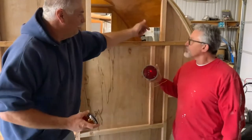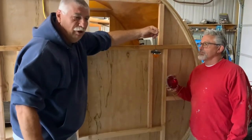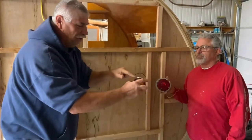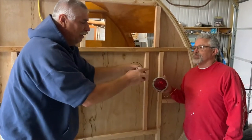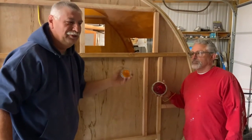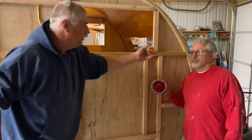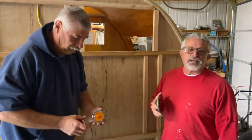Remember, if you've got your wire hanging out here and you connect it and the bulb's hanging out, it will not work until you put a metal screw into this plate into the aluminum side — you get your ground through the screw. You get your hot lead through this single wire. That's most of the problems with lighting on vintage campers — it's a poor ground somewhere. So always check your ground wire up front to make sure it goes to the skin somewhere. We're going to show you all of that looking great on the reveal.